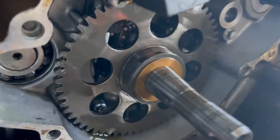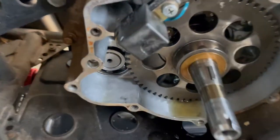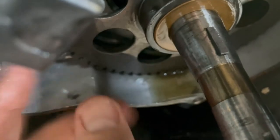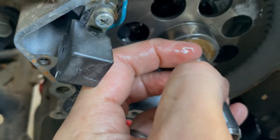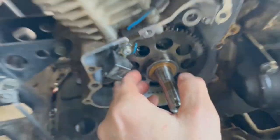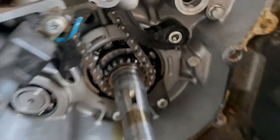There is a key right there — hopefully that stays in place. There's a washer and a gear. This key is just a little half moon sitting in there, and this just freewheels. I'll show you right here quickly — slide this key out. I put the whole clutch thing on just to see. I've got that key out — just push it down and out the opposite side. It came out pretty easy. That's what it looks like behind there — looks pretty clean.